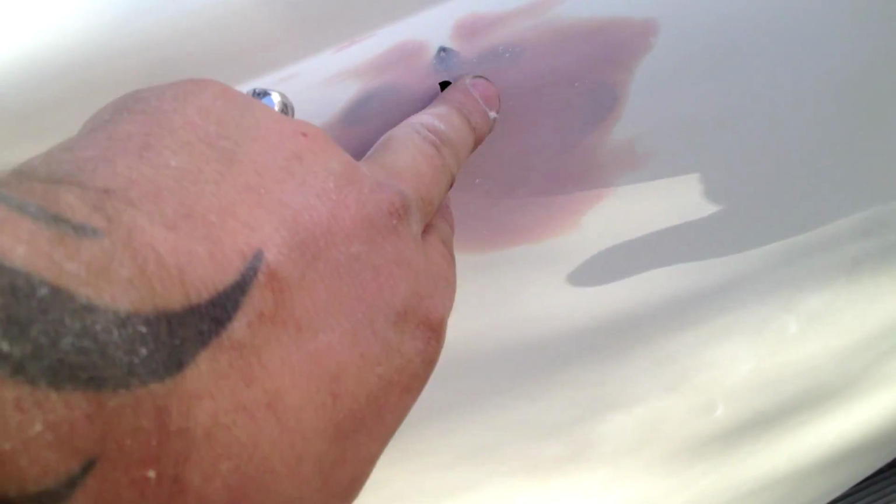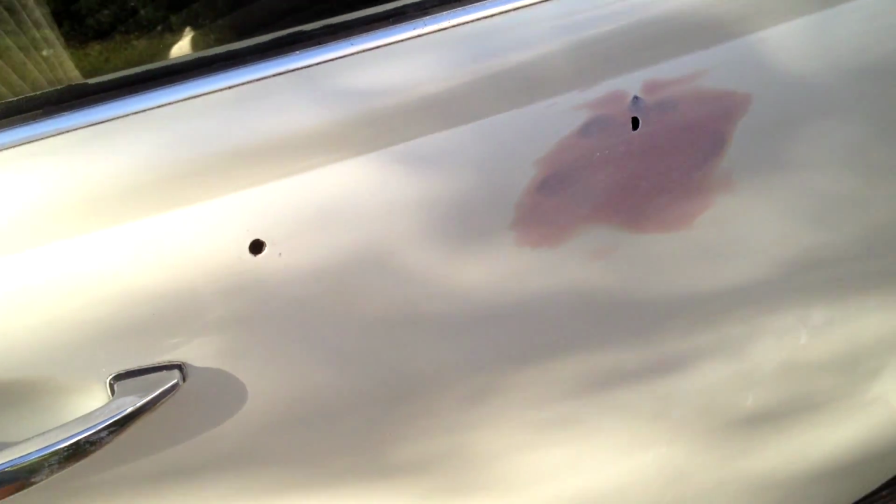There's my partner. Okay, I put a little Bondo filler on there, and you can see the metal through it. It's just right down this line here. It's still slightly dented in, and I hit it with I think 400 grit, and now I'm going to wet sand it. Started with 80, then did like 200 and 400. Same with this side. This one is pretty smooth to the touch. I really can't feel anything, and it was right there. It was eaten up with rust. It hadn't gone through, but it left a little bit of a cancer area, so I got that hooked up.